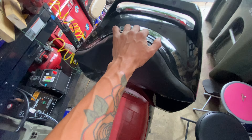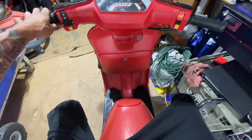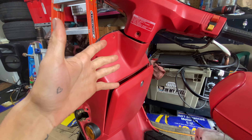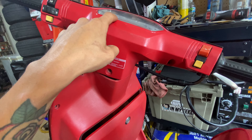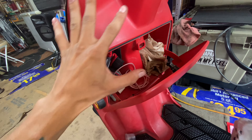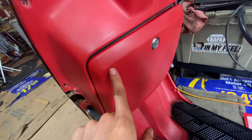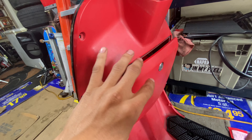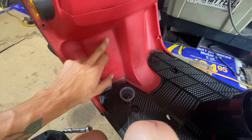The carb was just cleaned but eventually it'll need a new carb, and I want to do some stuff with the cluster, make some pegs maybe in the rear. This is a nice little cool project for me instead of cars, so we'll have a little side project. First little project - I went ahead and bought some 5/8 bolts, a nut, and a coupler so we're gonna make some pegs. I'm just gonna weld these pieces straight to the frame and weld the bolts straight to those pieces, and we should have a nice little adjustable peg back here.